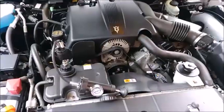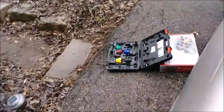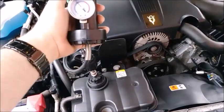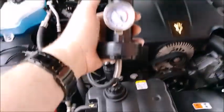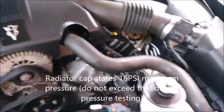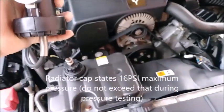We'll move on to our next test, which will be starting up and checking the battery, and then we'll do our OBD test on all the modules inside the car. We've got our adapter hooked up - that's the black one, number 22 in our kit for this Lincoln, probably the same for Mustangs and Crown Vics. Anything with this Ford Modular V8 has the same type of expansion tank. We are holding pressure constant at 13. We don't see any leaks, we don't hear any hissing. So this guy passes the pressure test.